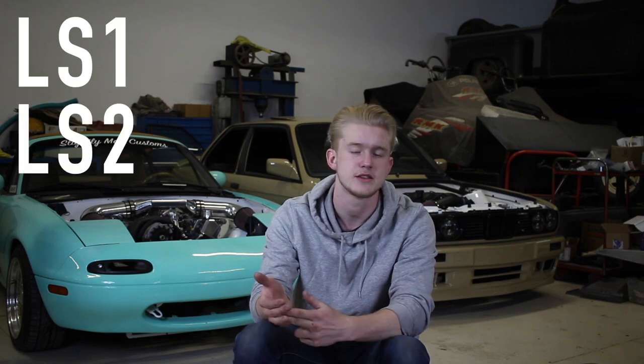When it comes to picking the engine for your LS Miata, it's pretty much just going to be whatever you want within the LS family — whether you go with an LS1, LS2, LS3, LS6, or any Vortec iterations, they're going to fit just fine after their required modifications. The only LS you're going to have a hard time swapping is the LS7, because the dry sump system and the longer stroke are going to interfere with your steering rack and your subframe.